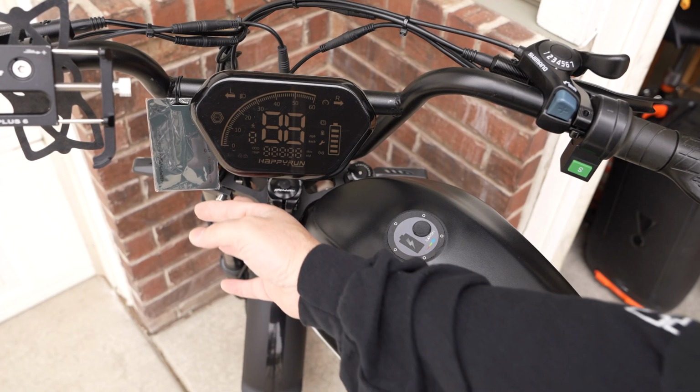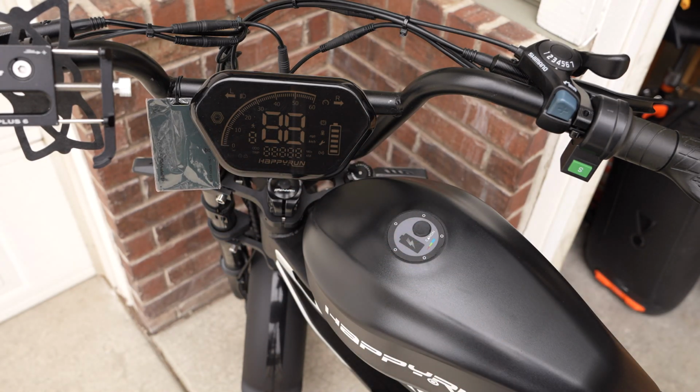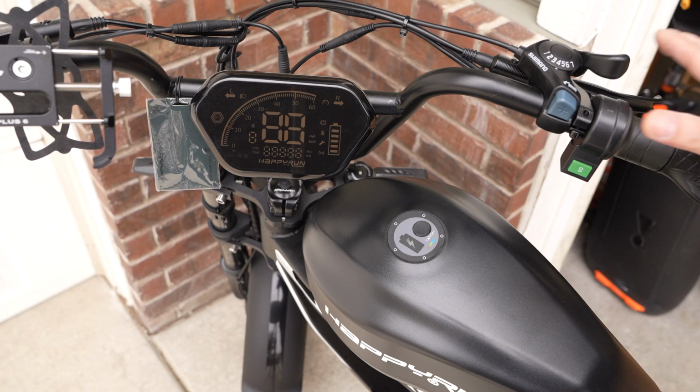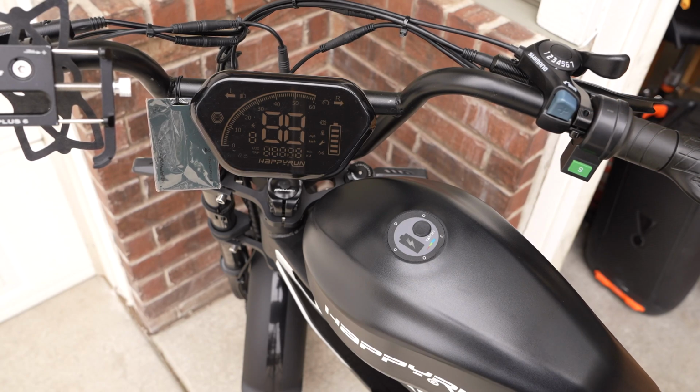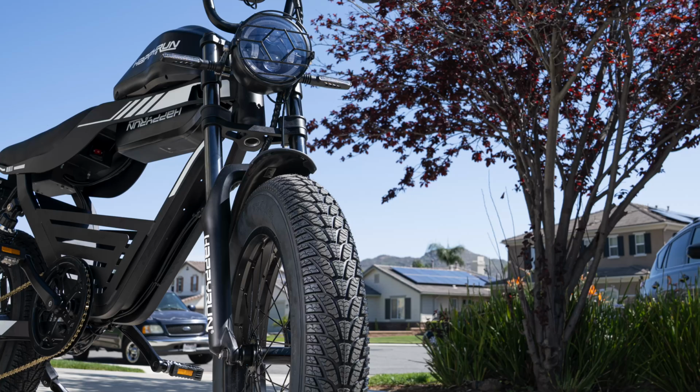I think you have to use the NFC card reader to unlock it. And then once you do that, to fully unlock it, you squeeze the brake lever 5 times. And that should switch it from the default, which is under the up to 38 mile per hour range. So give that a try if your bike isn't going fast enough, and that should help you out.